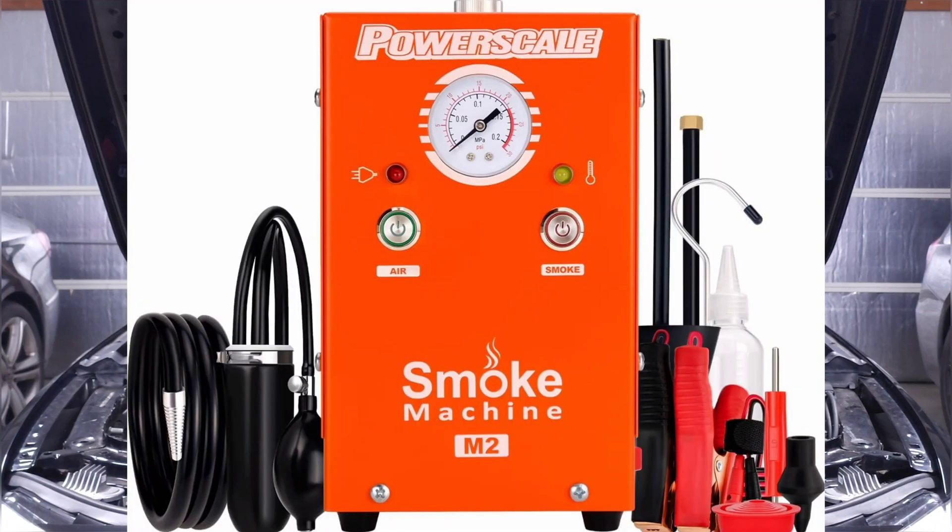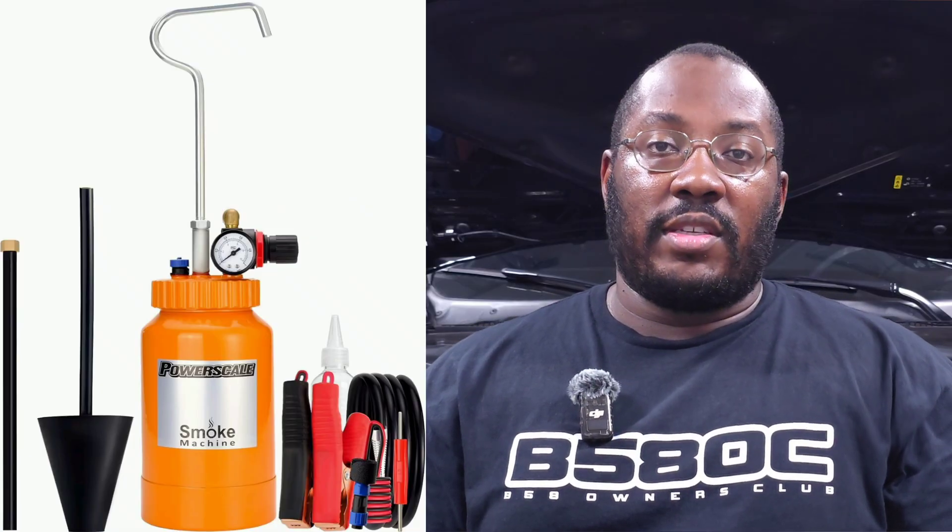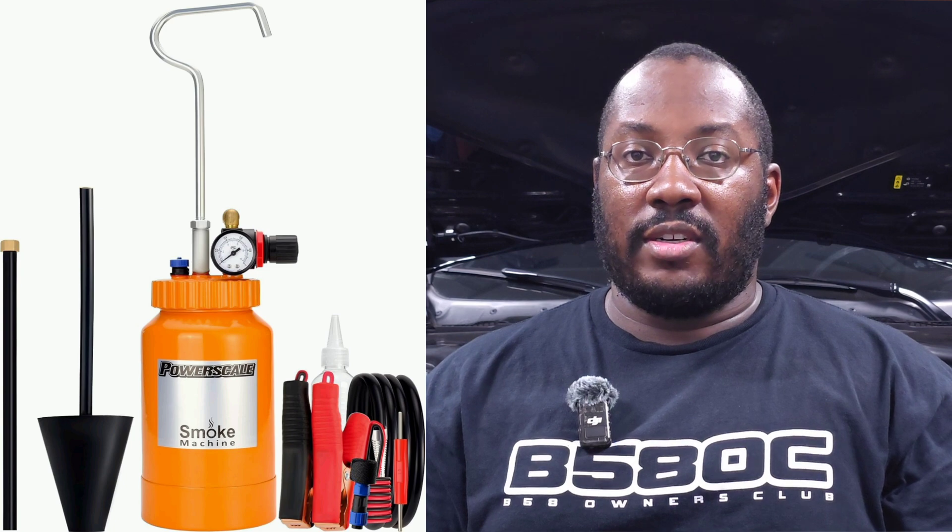Inside the unit you have the compressor that creates positive pressure as well as the heating element that heats up the oil and creates smoke — all in one unit. There are higher-level options: the next tier up has a gauge on the box so you can monitor pressure. An even higher version has knobs to control airflow and how much smoke it makes. The one I got is just on/off — it makes boost and pushes out smoke in one switch. If you want extra features, go for a higher-end model. Models without the box built in are designed to run with an external compressor for testing at 25–30+ psi.